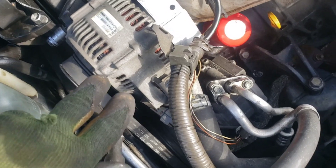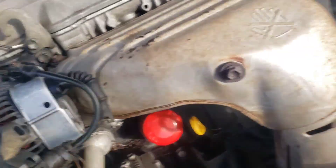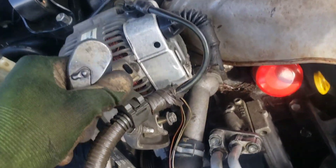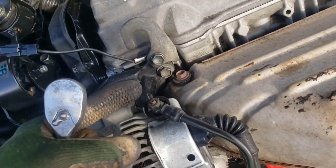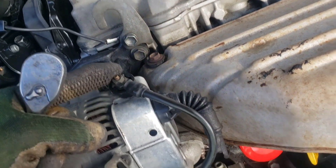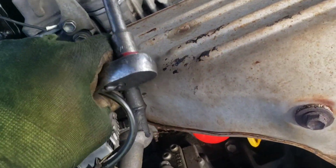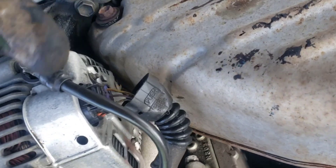Go ahead and loosen all the way down until you can take your belt — just slip your belt off. I'm also gonna take an 8 millimeter and take this nut off right here so we can get this off. Then we're gonna take a 10, take this nut off, and this will just move back — this little rubber thing right there.